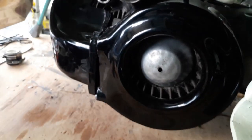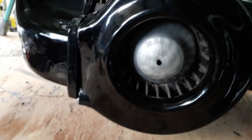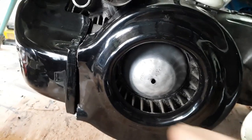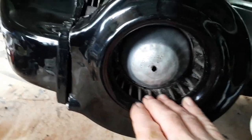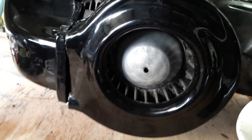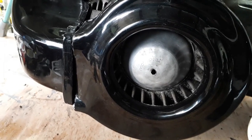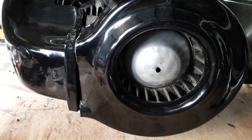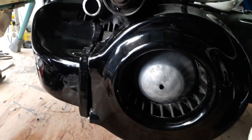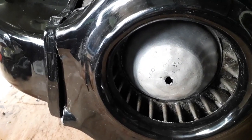That's how it looks when it's on with the domed centre. Obviously if you're running different flywheels like Casa or SIP, you don't have that domed centre cover, but you still have the bell mouth and the suction into the centre. I should think about making some centre covers to go onto the Casa ignition and the SIP ignition to increase the airflow into the fan — maybe that's a job for the future. But this is basically what I do with the covers to increase airflow, and the difference is quite substantial. Don't forget to subscribe, hit the little bell, and give me plenty of likes as well if you enjoyed the video. Merry Christmas to everybody — see you.